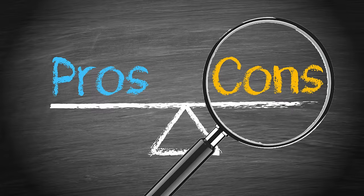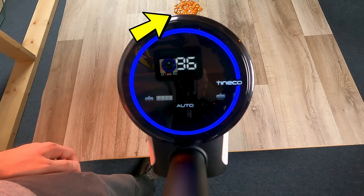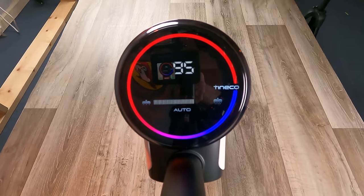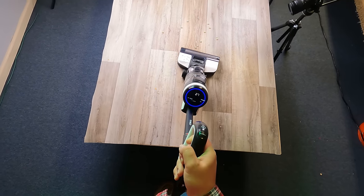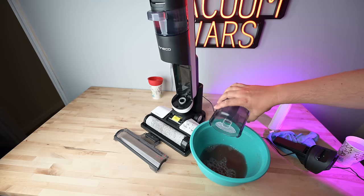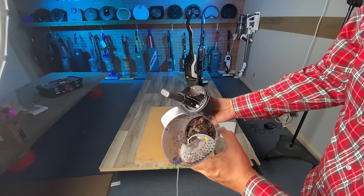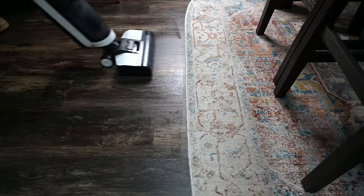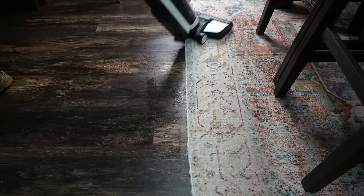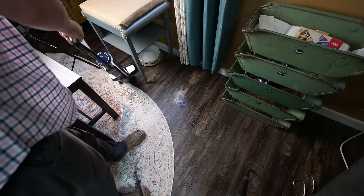As for the negatives I noticed: the auto mode sensor that adjusts suction was not very sensitive, so it took a pretty chunky mess for it to really kick in. On the other hand, I didn't really mind that because I'd prefer it not to be too sensitive — I don't see much benefit in more suction power anyway, and I'd prefer the longer battery life. The dirty water tank is mostly easy to empty in regular use; it has a little strainer for larger debris and hair, but if you pick up a lot of dry material it gets messy and you'll need to run water over it. I liked that water is automatically dispensed, but because you can't control the water flow, it's not recommended for rugs. You can quickly pass over a rug, but only if you don't mind it getting slightly damp — I did vacuum rugs a little with no issues, but it probably wouldn't be something to make a habit of.